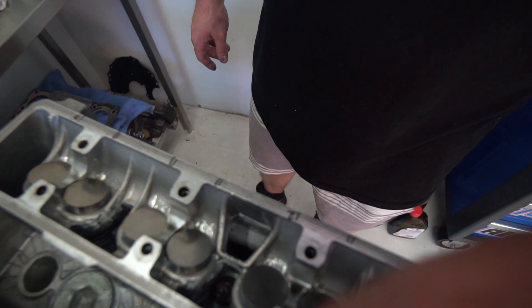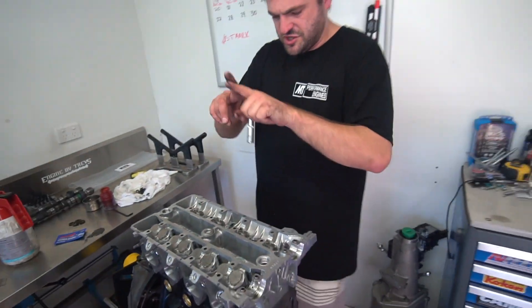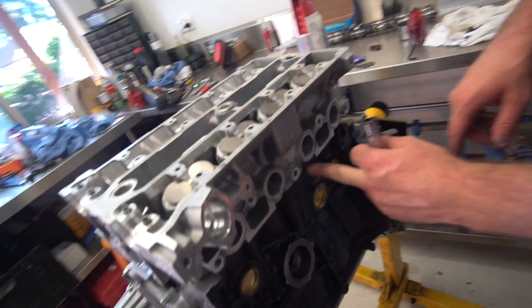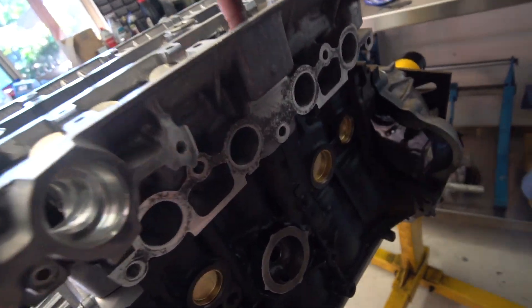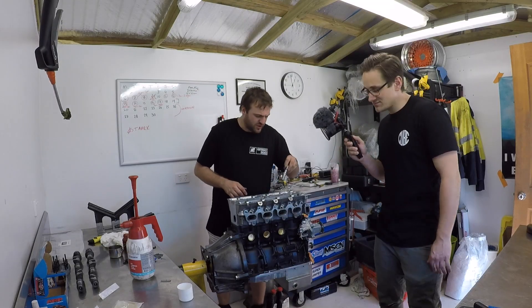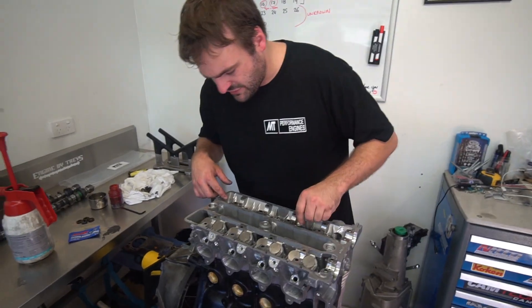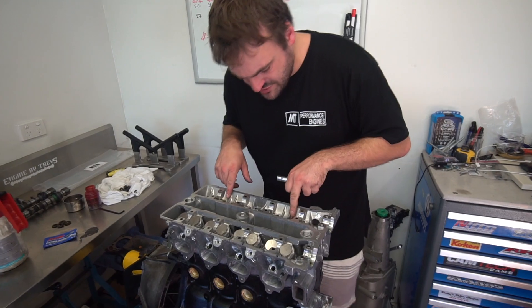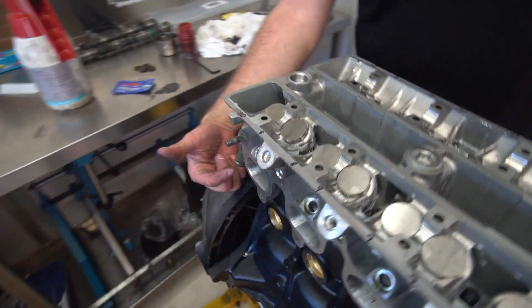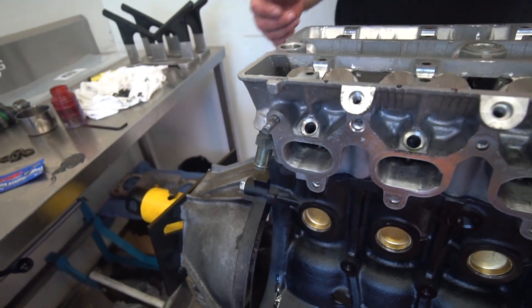Those breathers — there are like two ports there and it channels over. There's an exhaust bolt, but I've bored that out so it flows a bit freer — that's your breather. The only other drains in the 16-valve 4A are two on this side. On the small port heads they added a rear head drain on the back corner just to get the oil out of the head, so the small port was a far superior head.